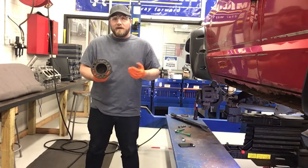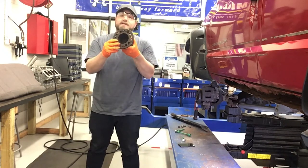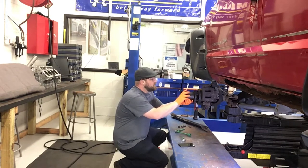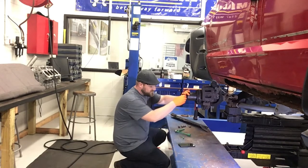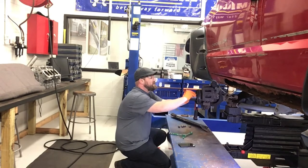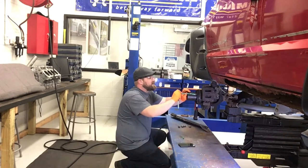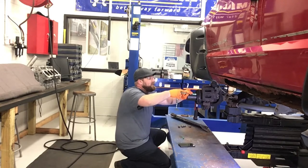I'm here in the front left corner of the car and I've got my hub adapter. I need to guess and check and see which one of these sets of holes is going to go around through the wheel studs. Once I've got that on, I need to use a regular ratchet and extension to thread these on. We're not going to use an impact on these because that can damage our flanges. So we just put them all on in a star pattern and just snug them up so we know it's on here flat.